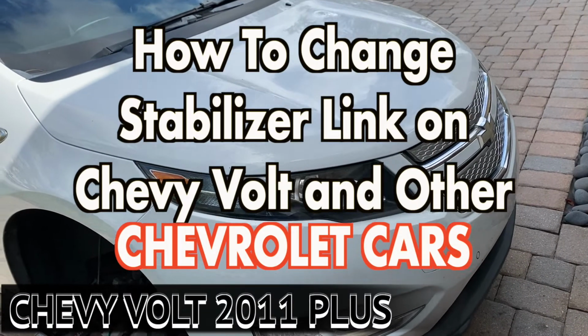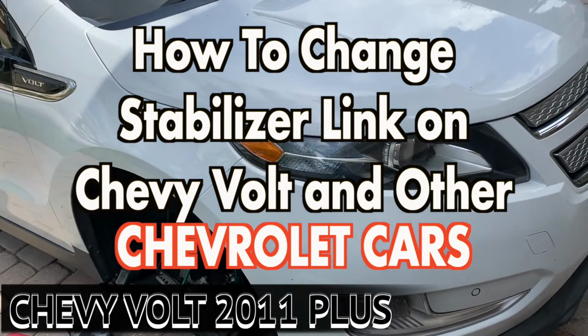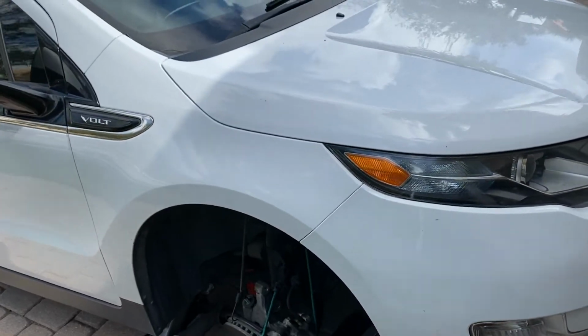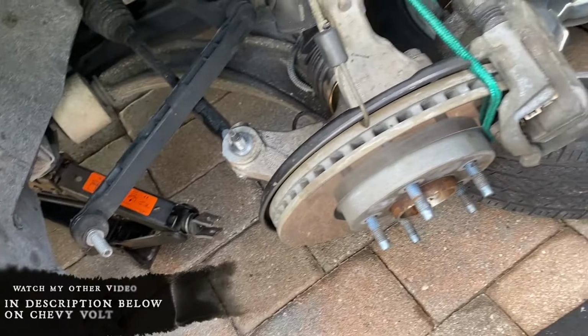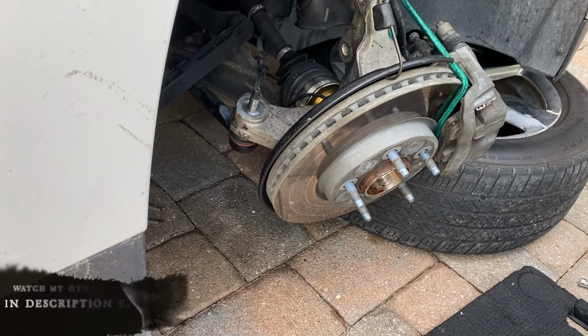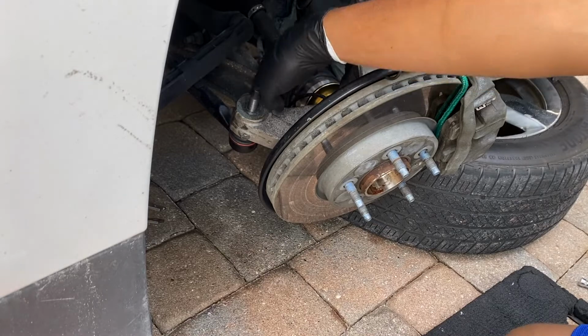Hi guys, so this is my dad's Chevy Volt. It's a 2012 model. In this video, I'm going to be showing you how to change the stabilizer link. So I was working on this car, fixing that famous clicking sound. So I did fix that. If you want to see the video on how to fix that, I'm going to leave a link in the description below. But in this particular video, I am going to be replacing the stabilizer link, which I found is bad. The rubber on the stabilizer link is kind of deteriorated and the dirt probably got in. So let me show you exactly what I found.